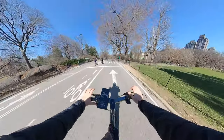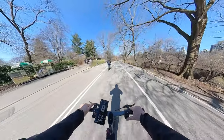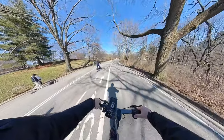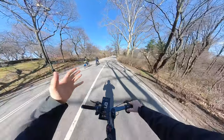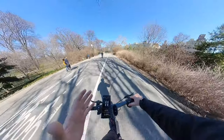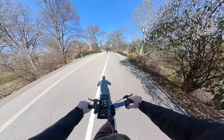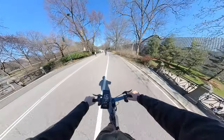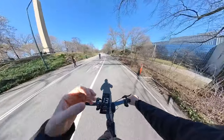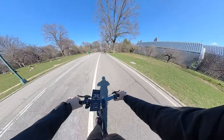Brakes are perfect. The controls are amazing — it's on the smooth side compared to the previous scooter I reviewed a couple days ago. This is way smoother; it doesn't have that kick. You can set it up to be aggressive, but even on the smoothest setting it's very intuitive, very gradual, very user friendly. At maximum speed it has that pull and kick so it's more aggressive. My intuition tells me this is 20Ah at 48 volts versus the other one at 52V 18Ah — probably the same cell count, just different configuration.